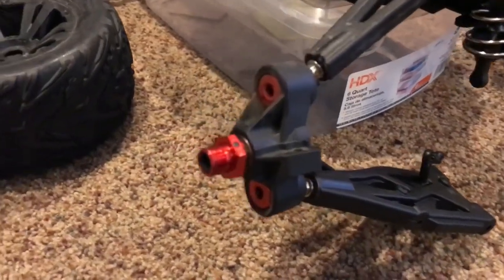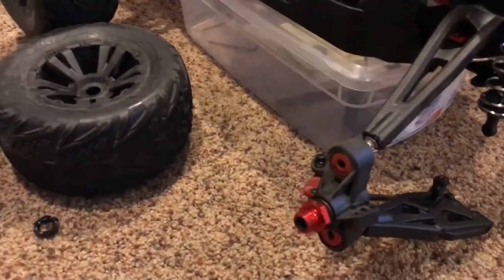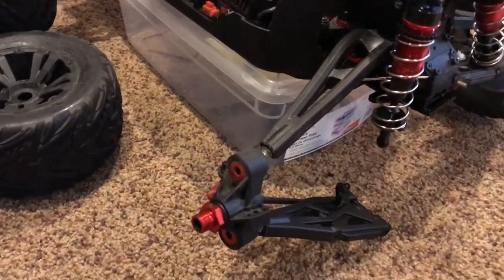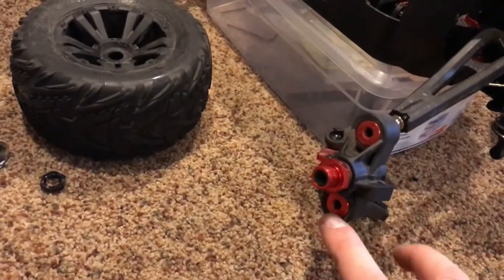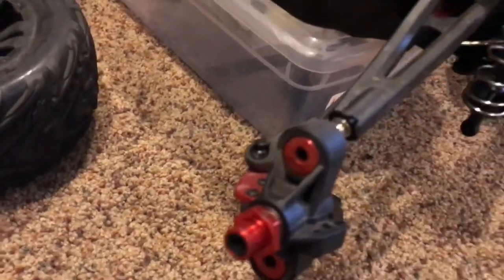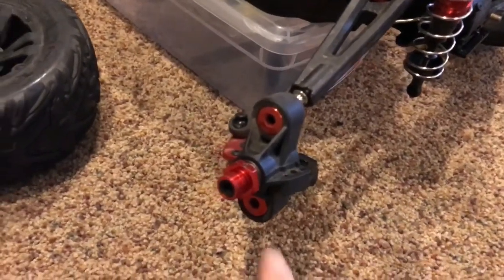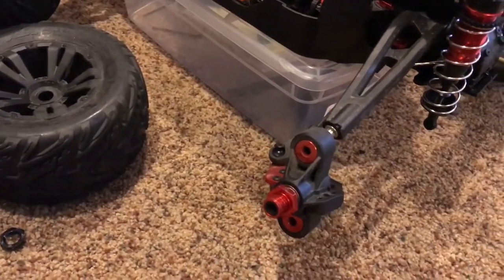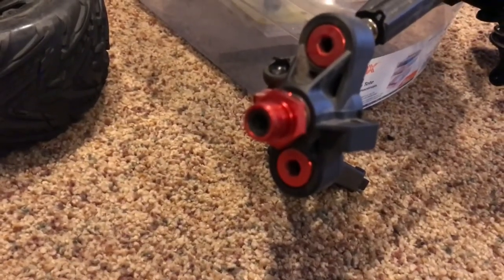I have it back together. Just a quick note when you're reassembling everything back here: there are no threads on the new A-arm, so you just kind of have to thread it in — it's just a self-tapping bit there. When you put this anodized cap back on, it's just a cover. There's a plastic piece in there; the plastic piece goes with the flat side in and the beveled piece out. This kind of goes around that beveled piece. When you screw this back in, make sure you don't tighten it up all the way.